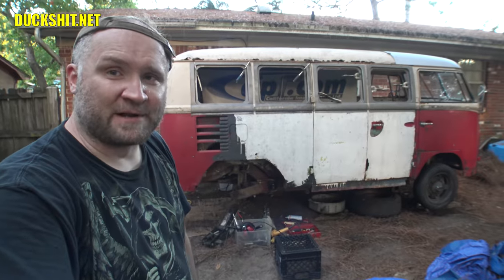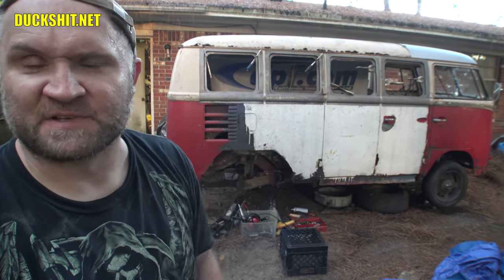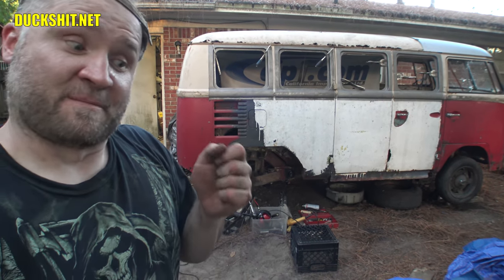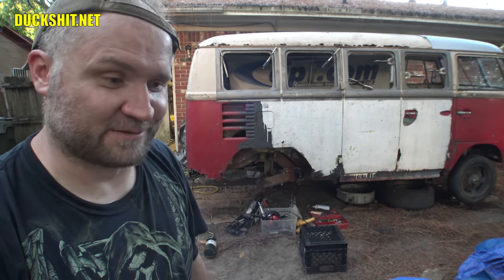I'm just gonna about wrap it up for today. Windows was just a bonus video. I'm still fighting with the spring plate down below. I don't know, I heat cycled it several times. I didn't show it on video, but I heated it up for about 10-15 minutes. The rubber bushing on the back side of it, I mean, it was smoking and burned pretty good on the back side, so it's gonna have to be replaced anyway, which doesn't surprise me.